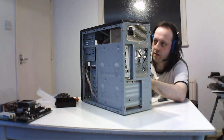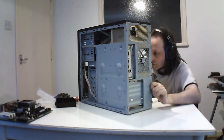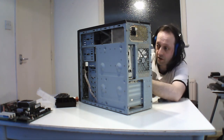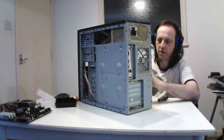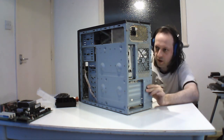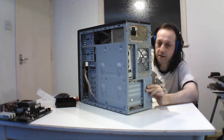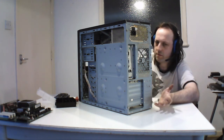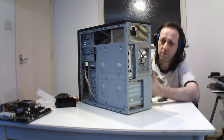So yeah, this is an actual USB 2. There's 2 front headers on here for it. There's only 2 SATA ports. At the time they were slowly coming in. You can fit 4 on the board. It's 2. And like I say, I keep a spare one here for the drive. There's 2 ports to use, one for the drive, one for another one to hook in. And it also has a floppy controller and still got an IDE controller because they were still swapping over. So I've only got one IDE controller. I still have this because, like I say, I can access IDE hard drives for this and SATA drives. So this is good for doing test purposes.